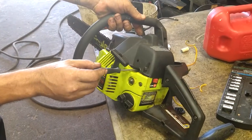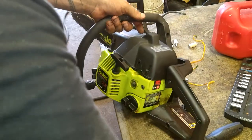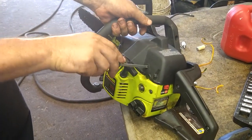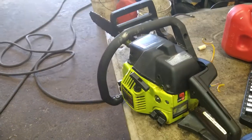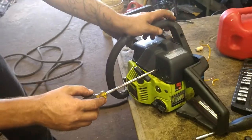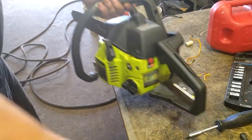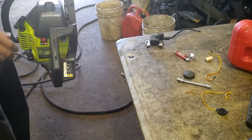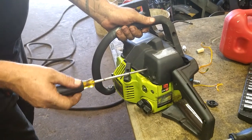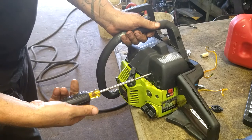The idle side — you can either do the air-fuel mixture or you can tighten that screw in. We're just going to tighten the idle screw in a little bit. Let me find the smaller tool. We're going to reach in there and turn it clockwise a little bit. A little bit more. You'll feel it falling into place — there it is. A little bit more.